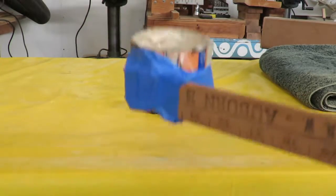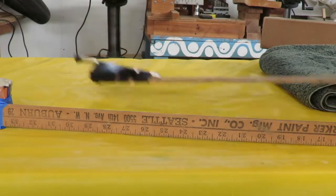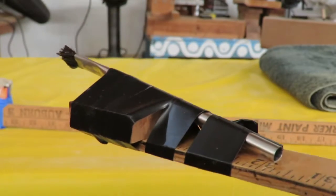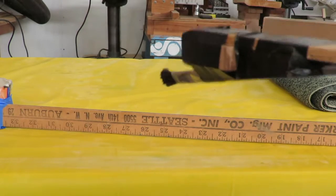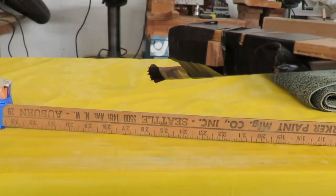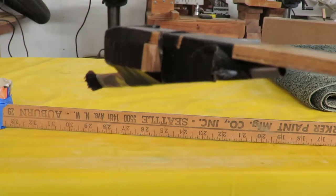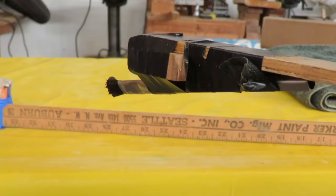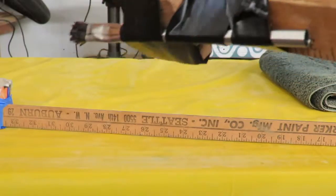The only problem with this is we won't be able to reach all the way to the very bow because the bow gets too narrow, and so that's where the brush comes in primarily, although we can also brush the bare wood on the bottom side of the deck to make sure that's all coated. But the brush can be used just to push the epoxy, urge it forwards up into the bow section, the last 4 or 5 inches, where we can't be pouring it because the container we're pouring from won't fit up there. So that way we get an even amount of epoxy the entire length, it's about a 2.5 foot length, I guess, or might even be 3 feet, but 2.5 feet or so. And so that is the equipment we need.